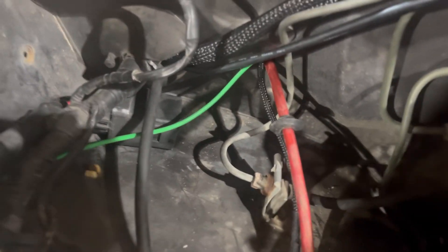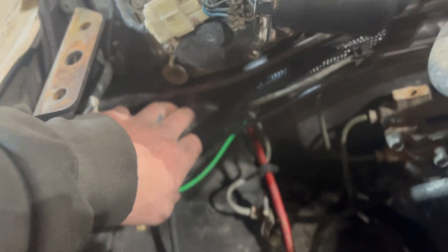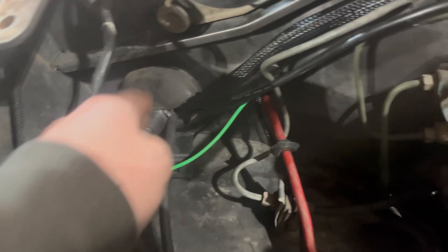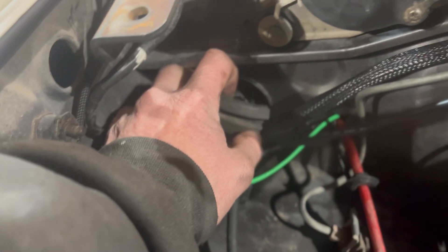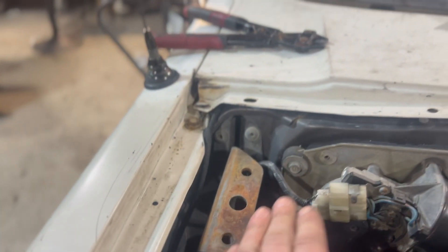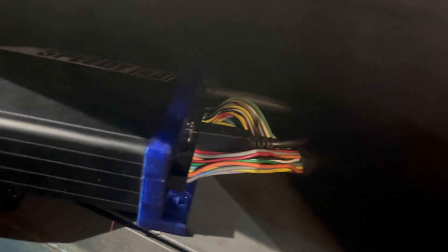As you can see down in here — excuse the stock mess of wiring. My truck isn't perfect and I'm expecting yours not to be either. This little rubber grommet right here — I literally cut a straight line in it all the way across and shoved the harness in it. You can pull this rubber grommet out and as you can see, I have pretty much cut it in half to shove the speedy plugs through the firewall and up and over the blower fan.